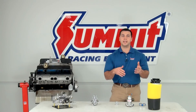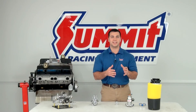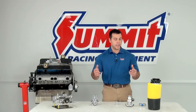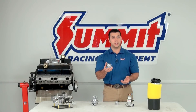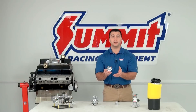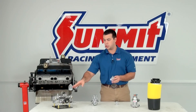You can use an electric fuel pump for a carbureted application. There are electric fuel pumps designed to run at low PSI so you're not blowing your needle and seat. But if you do get a stronger fuel pump, again run a fuel pressure regulator — you have your fuel pump, then your fuel pressure regulator, put your return line back to your tank, and put the outlet line to your carburetor.